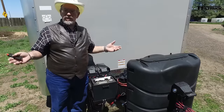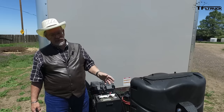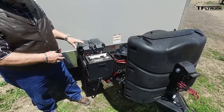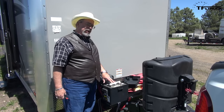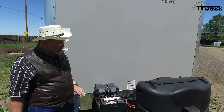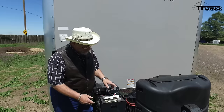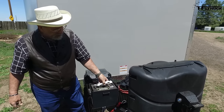In an RV, when you go camping out in the wilderness, not necessarily in a trailer park, you want really good batteries. You'll charge off your 110 outlet, trickle charge off your truck, and we're going to put a generator on here. This here is two deep cycle batteries — they're actually called golf cart batteries. They're six volt, not 12 volt. Hook two together and it gives you more drawdown power. A regular deep cycle battery you can pull down a lot, but these will actually go all the way down to zero and you can charge them back up, whereas a lot of other deep cycles — if you pull them down too far, you've killed the battery. On these batteries, you want to check for corrosion on every electrical connection, whether it's plugged into the truck, plugged into shore power, or the batteries themselves.